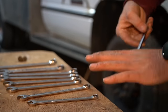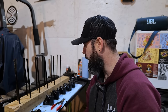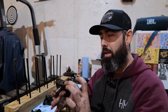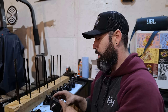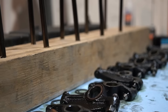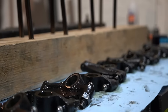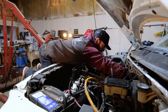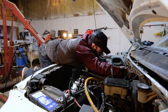I don't plan to add any more power to this engine, but I am upgrading to head studs instead of head bolts. The thing about going to head studs is the rocker pedestals need to be milled down — with head studs they protrude further and there's not enough clearance to get your valve cover on. Some people dremel out the fins on the valve cover, but I think milling is probably the better way to go. Just trying to be super organized so everything goes back in the exact same spot. Now this head is ready to come off.